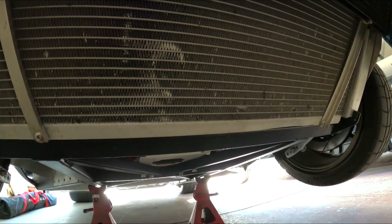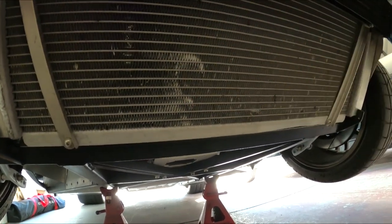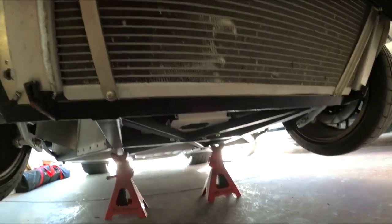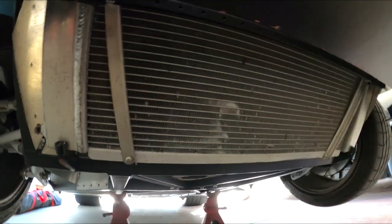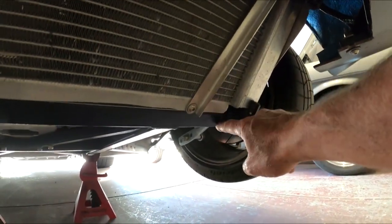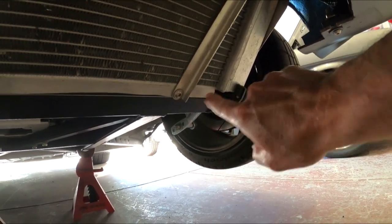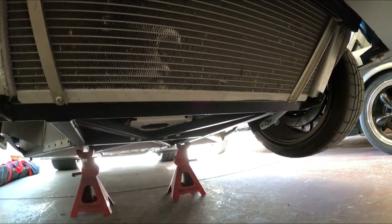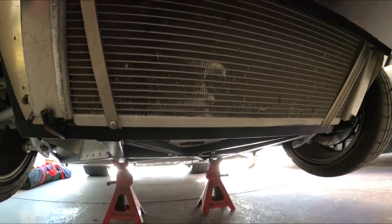I hate to lose a radiator. The oil pan is pretty thick and would be hard to puncture, but this radiator — not hard at all. A raccoon almost did me in. So my plan is to run probably 1/16-inch steel, nothing major, and I'll probably put a couple of little gussets in it. It's going to go between here and here, come out, and then I'll cut and re-weld it and stitch weld that all the way across. Hang along here and we'll get this modification going to hopefully save this radiator before it's too late.